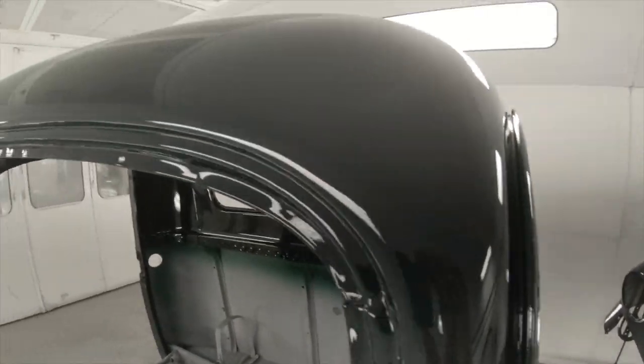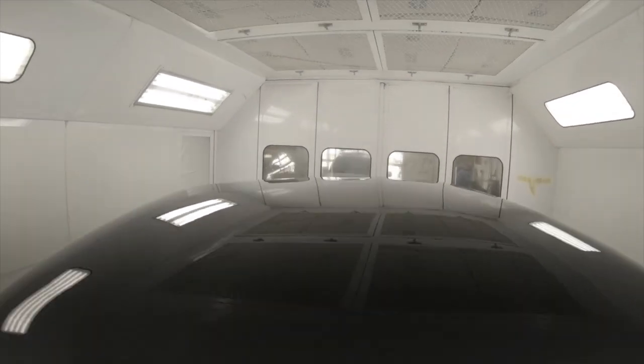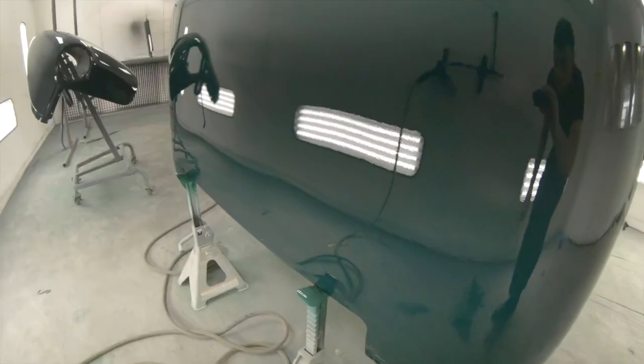I used Sherwin's CC950 clear coat. It sprayed absolutely amazing. I reduced it with their US5 reducer and put 5 coats on, so I have plenty to cut and buff. I did not get any solvent pop, for those of you who are wondering.